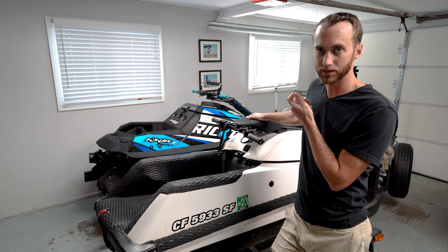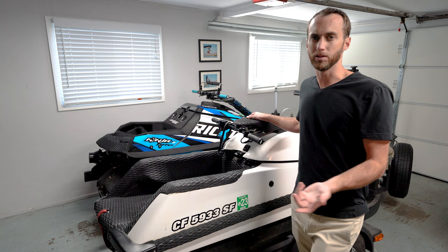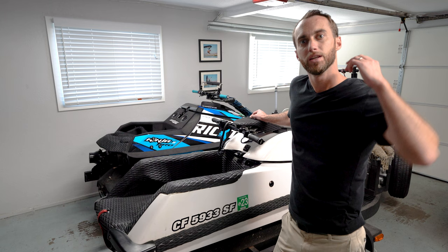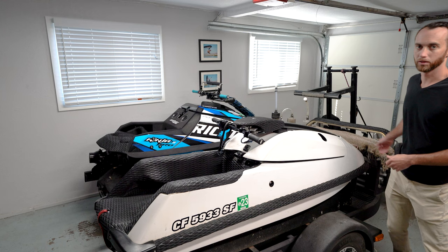So with these, any of the Yamahas, you're gonna have to mix the oil in with the gas beforehand. I usually do 40-1. I think Yamaha recommends 50-1. I think you'll be in pretty good shape either way. But you're gonna pre-mix the oil into your gas. So if you have a 5-gallon jug of gas, you're gonna wanna put 16 ounces of 2-stroke oil into that jug, shake it up, and then dump it in. The fill is up front here.